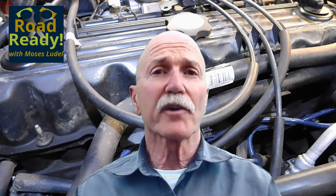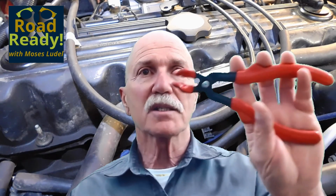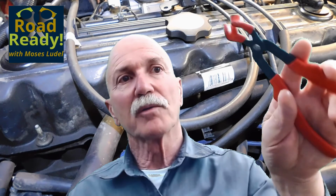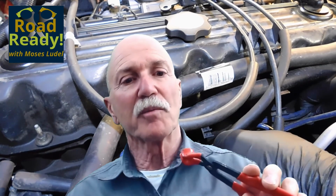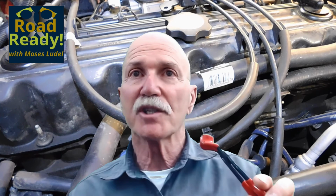I'm going to share some variations of the boot removal tools. This is a tool that we're using in this project. It's a KD tool, readily available. If you grip below the top of the boot and hold firmly as you pull out, you can generally remove the boot, wire, and terminal intact without damaging anything.